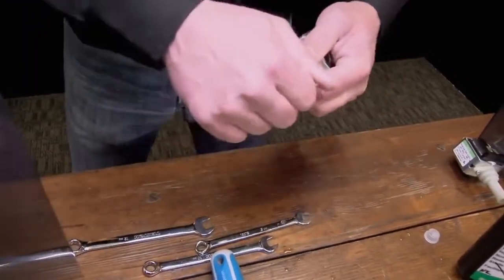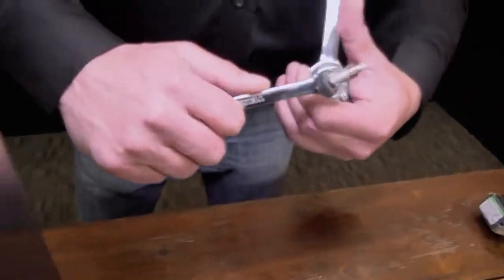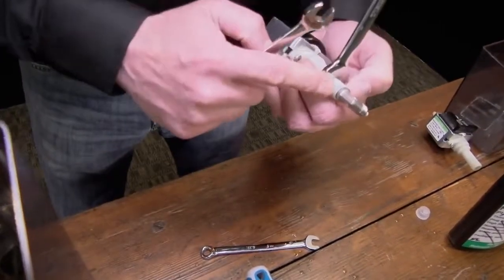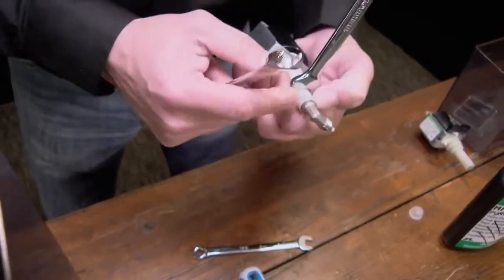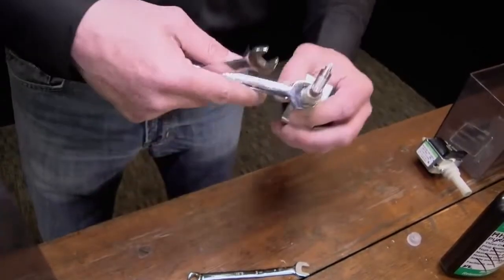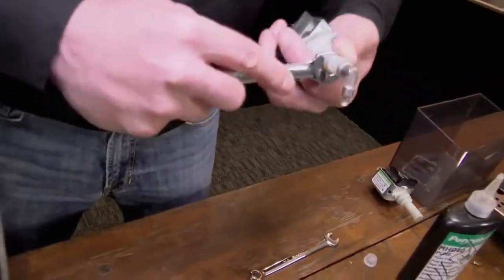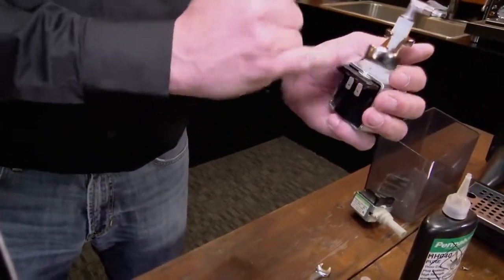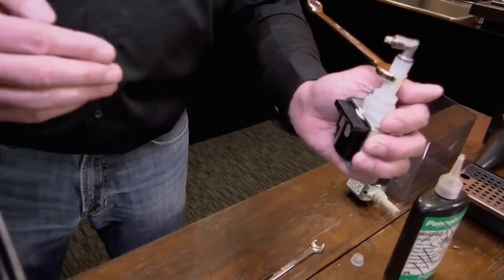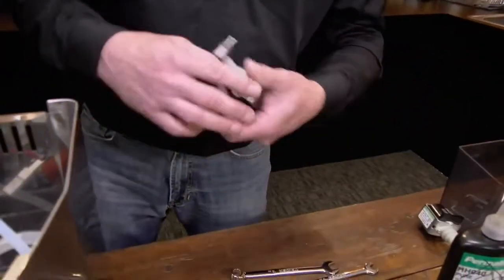Now you go as tight as you can with your finger, then put the 12mm wrench on and grab one of your smaller wrenches. Basically hold one wrench and give the elbow just a little snug with the other — you don't want to overtighten because you'll start compressing the neck with the collar on the elbow and crack it. Just go finger tight as much as you can and then give it a quarter turn. One important thing: the elbow position needs to be facing the same direction as the wire connectors, because that's the way it was in the machine. Turn the neck so the elbow faces the same way as the connectors — this ensures it lines up when reinstalling.